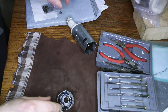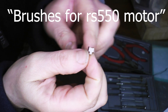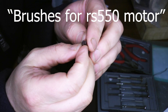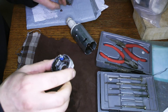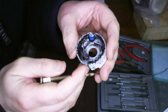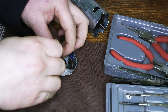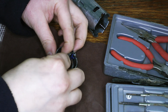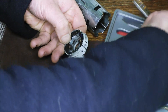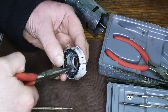I need to get this worn brush out, which may be interesting. I have ordered some replacement blocks from eBay which I think are an identical fit — they come in packs of nine. So I'm going to try to get the new one in to replace the one that's worn down. Weirdly, this side hasn't worn down much — this side's worn down a lot. So I'm going to try a bit of levering to see if this will pop out, but I think it's probably going to involve some pliers and scrunching it up a bit.